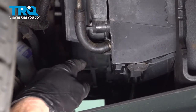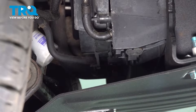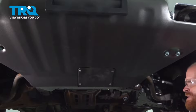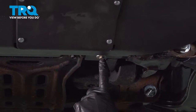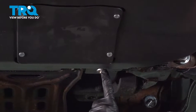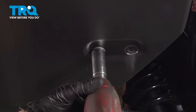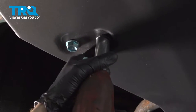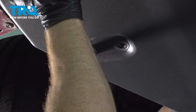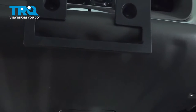Make sure you have a way to divert that coolant down into a collection bucket — if you have a hose of some sort, put that on there so you can recycle it properly. We're going to remove the skid shield to get a better view. Starting from the back, you'll have two mounting bolts. Loosen using a 10 millimeter. Once loose, it should slide rearward once the forward bolts are out. Hold the plate as you remove the last bolt, then lower down the front and slide it rearward to remove it.